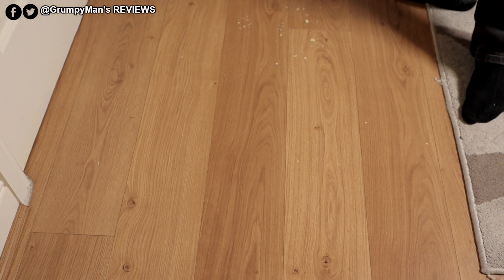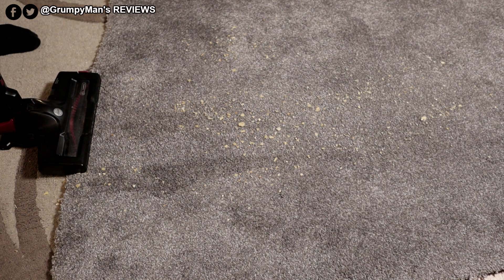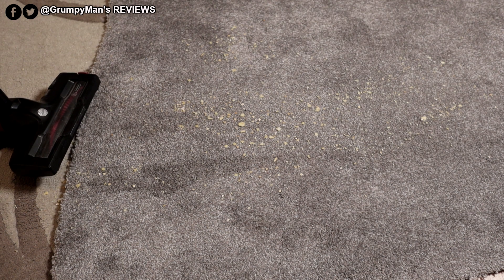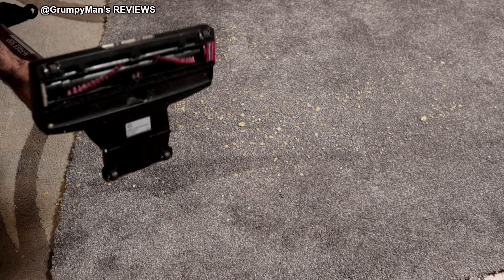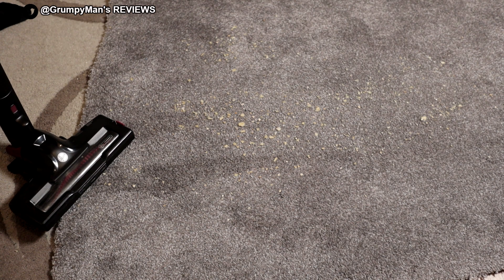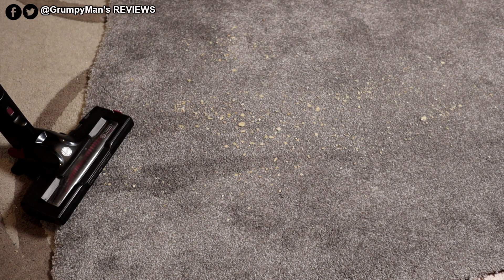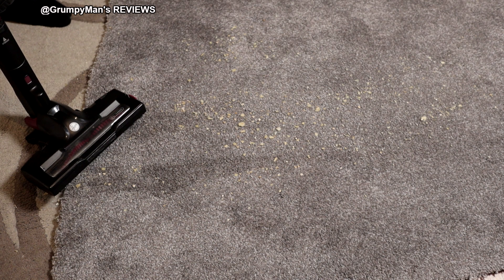Clearly it hasn't done well on hard floor. Moving to the carpet — there are fewer crisps and rolled oats here because I already tried this but it failed. The motor went really loud and started getting hot, so I checked for blockages and yes, the head at the bottom was completely blocked, as was the pipe. This rug is still letting fibres out as it's new — I only got it to test vacuum cleaners, it's a thick pile rug. My daughter's thick pile carpet also caused clogging. I'm redoing this with less debris. The front head has LED lights, which is great for vacuuming in the dark or under furniture.